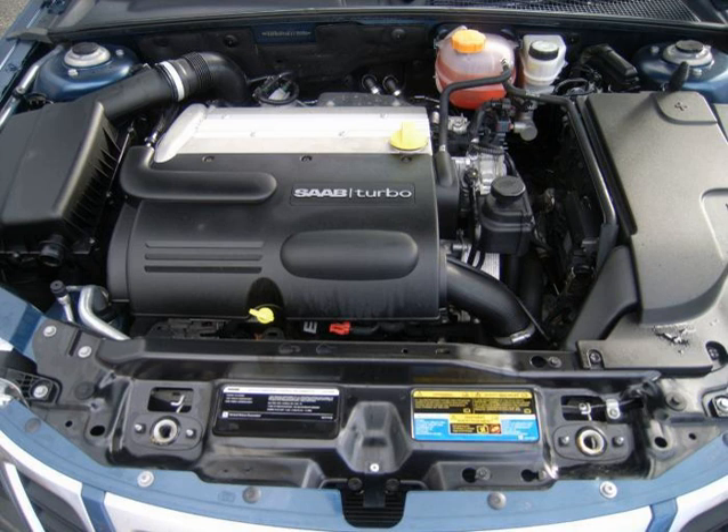The engine uses a reinforced Gen 2 block. Connecting rods are GKN forged C70 powdered metal from July 2007 on. The LE5 is also used in the following overseas models: 2006 GM Taiwan Buick LaCrosse, 2006 Shanghai GM Buick LaCrosse, and Buick GL8. The LE5 or a close variant is also used in the Polaris Slingshot (announced July 27, 2014), coupled with a 5-speed manual transmission and a final belt drive. The Slingshot is a 3-wheeled side-by-side street vehicle classed as a motorcycle.